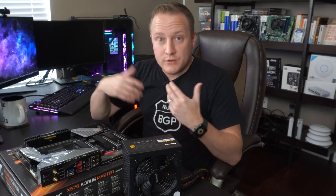We are doing all the CPU cooler testing with a Ryzen 9 5950X. The reason I chose it is because it is the highest power-draw CPU that Ryzen currently produces. So if we've got a good budget cooling option that works with that one, then it's going to work basically with the full lineup.